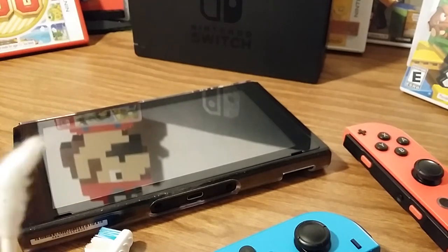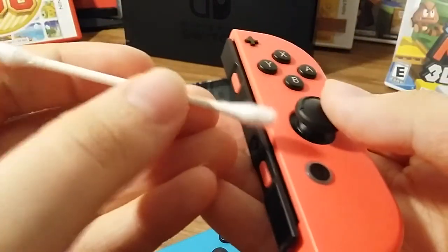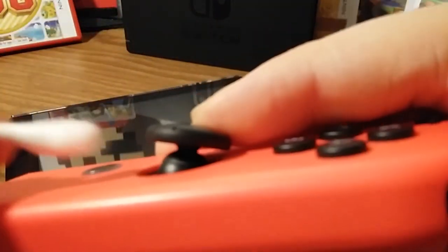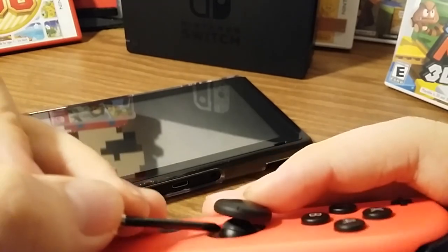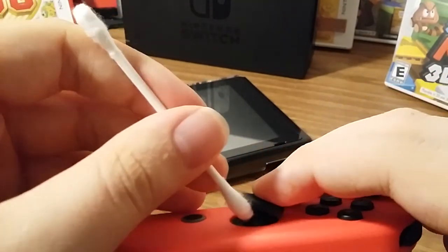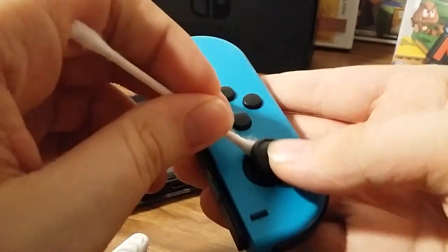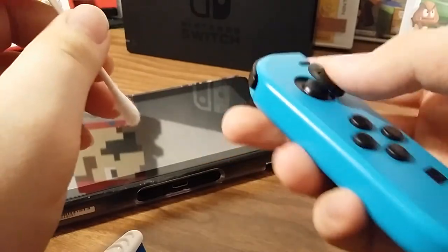You can also take two brand new cotton swabs that haven't been used. Pull back the thumbstick and just rub the cotton swab in there to get any dust out. There is also a little rubber cap on Joy-Cons that covers up the area of movement for the thumbstick. Since dust is attracted to rubber, if you rub this little piece of rubber gently with the cotton swab, you might be able to get some dust off it. Do the same thing to the left one - just wipe off any dust that could be on that rubber cap, and then it should work.